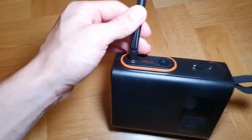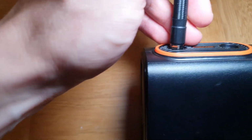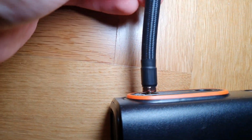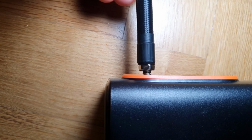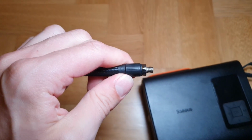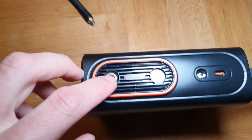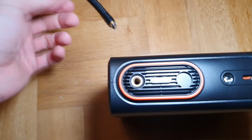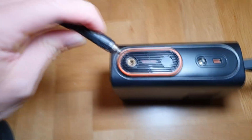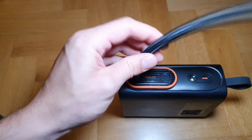So guys, as you could see at the end of this last clip, there is a little issue with this device. That is a rubber gasket between this hose and the device itself. The problem over here is, originally there is a small silicone rubber gasket that gets overtightened very easily, and as you saw in the video, it just kind of blows away, goes to the side and creates a leak. So what I did simply is I removed this rubber part over here, and this works wonderfully. Pretty much you can tighten it pretty good right now, and this won't give you any issues.